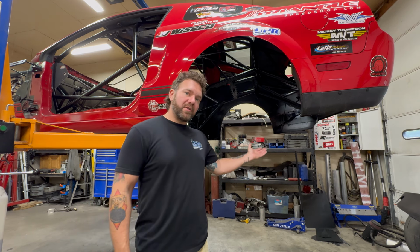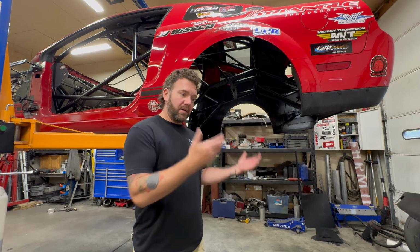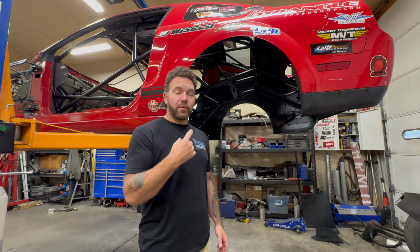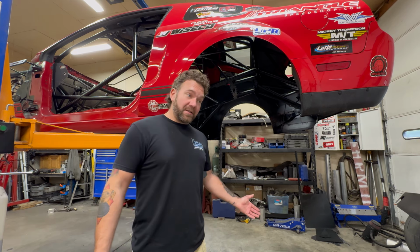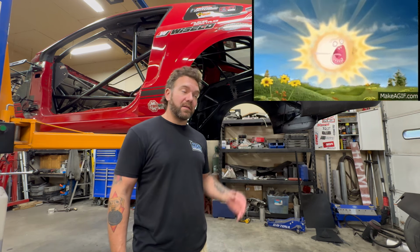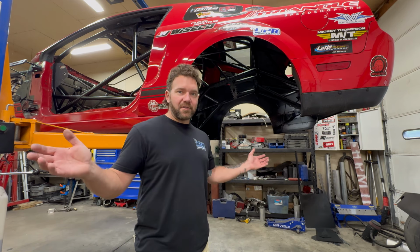First, containment pans underneath the engine and transmission. I make them two separate ones because when we get back to the pit, we like to take the transmission one down and put a fan on the torque converter. That's because it's probably the same temperature as the surface of the sun when you get back, especially on a turbo car. And they catch all the fluid when one of these blows up. Not mod motor, just all race engines blow up.